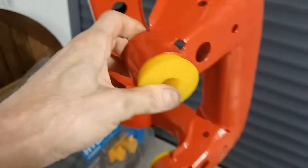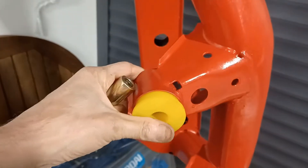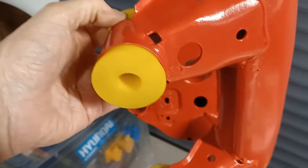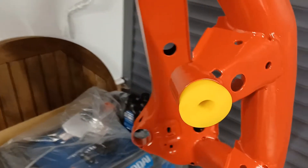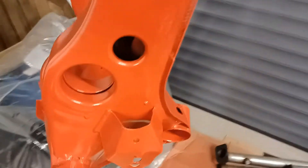Just push in one side, then push in the other. For the sleeve, I think I'm going to have to do the usual thing of dragging it through with my extractor toolkit and dragging it into place - because it being in two halves, if I try and thump it in, it will just push the other side out. So we'll have to do it that way.